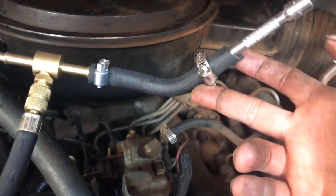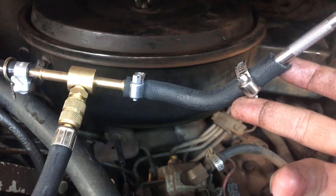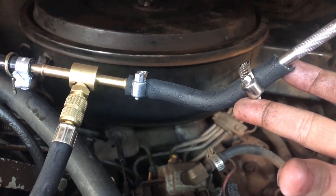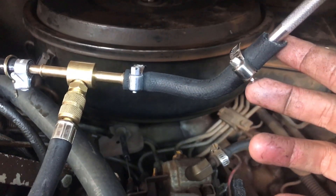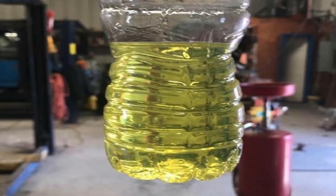When I did this off the tanks, I'll show a picture now of how much fuel I got out of it — and I only had barely four PSI. Doing the same test with it running off the can, I got six PSI, which is the max you'll get off one of these mechanical pumps, and I got this much — I'm gonna show you in the picture now.